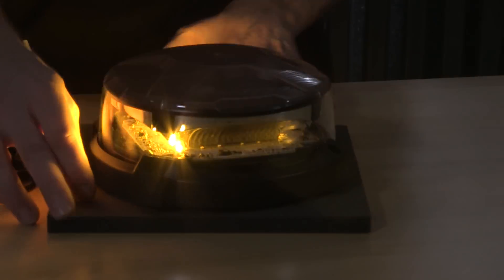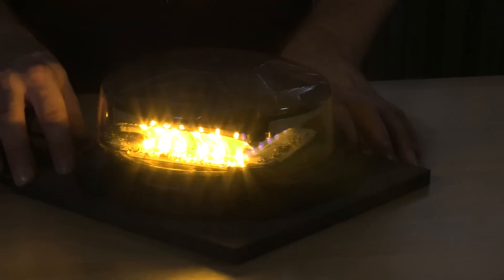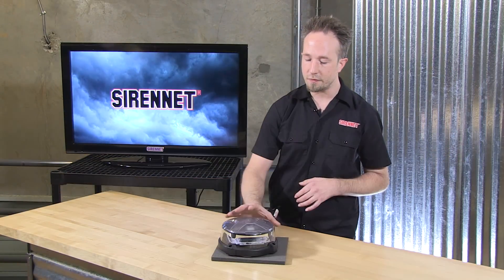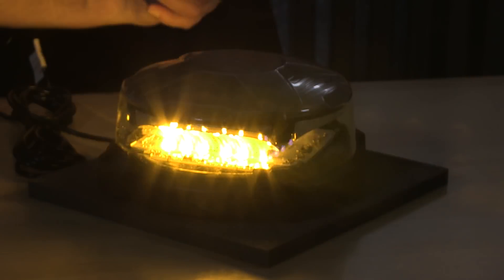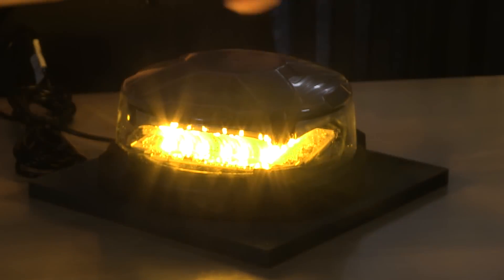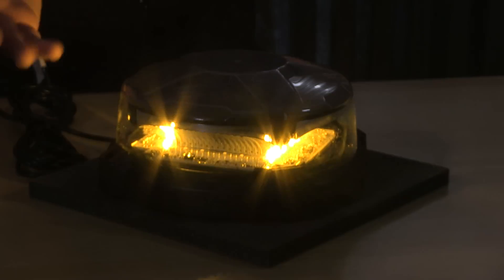A great thing with this product any way that you see it is its amazing potency — 360 degrees in a class one. In this case it's designed just for your 12-volt electrical system, and in the solo color even the most rapid flash pattern is going to only draw one amp. So it's very accommodating for your electrical system, including utilizing this without the vehicle being on and idling.